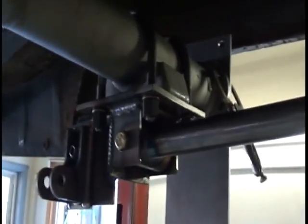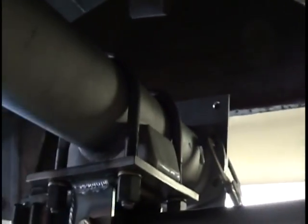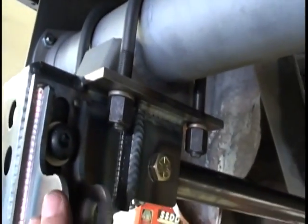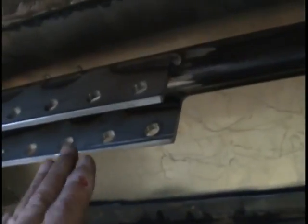Okay, as you can see, we've got the lower links installed on the housing and in the front perch pocket. The lower's done. The only thing left to do now is attach our adjuster bars. It's just a matter of slipping them in place. That's what sets our pinion angle, guys. We'll put those in place now, and the only thing we'll do after that will be to install the coilovers on the back side of the housing up to our bar.